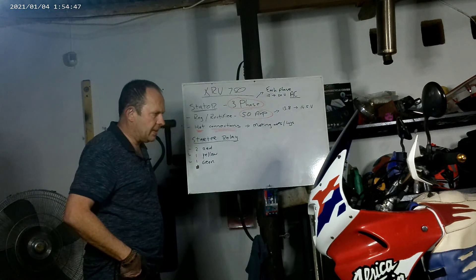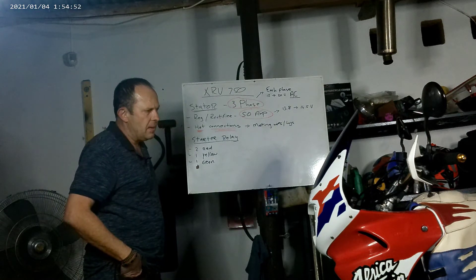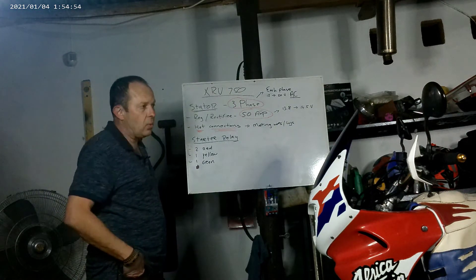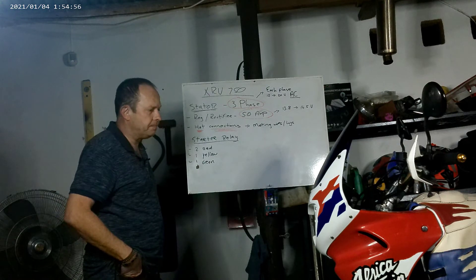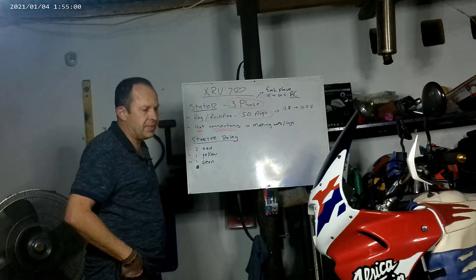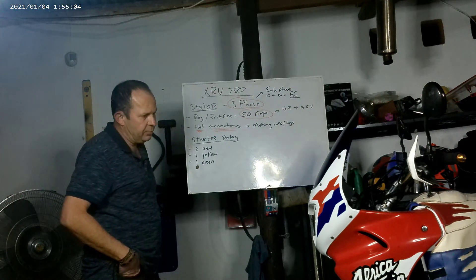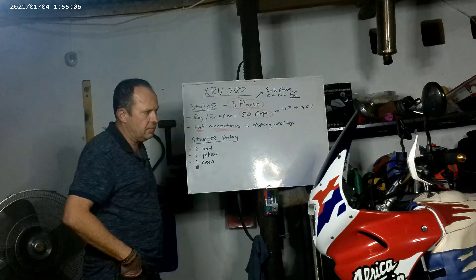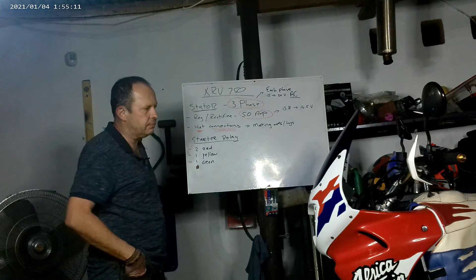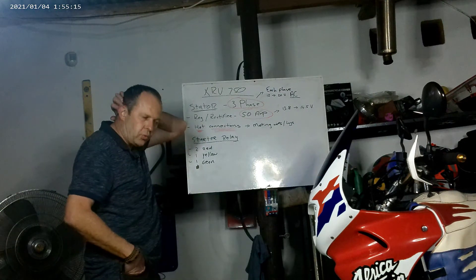On the riding simulation: if you're riding and your voltmeter starts going high - up to 20 volt - again that's a sign that your rectifier has packed up. I had pushed at some stage 20 volt through, which I could physically see on the voltmeter, and it didn't damage the CDI - so maybe I was just lucky. But it didn't damage it, so I'm all good with that.